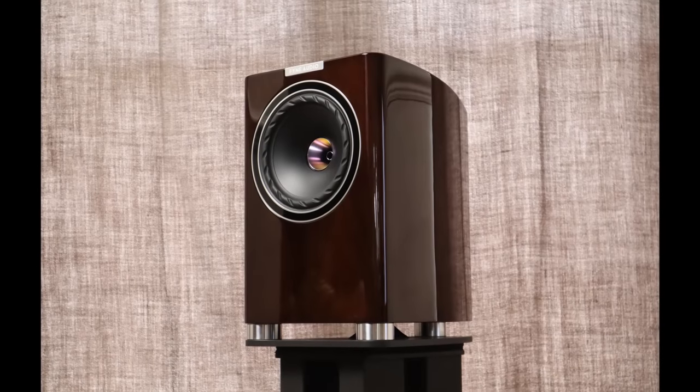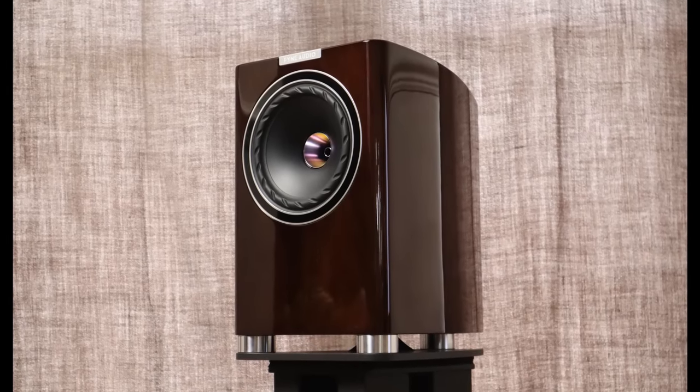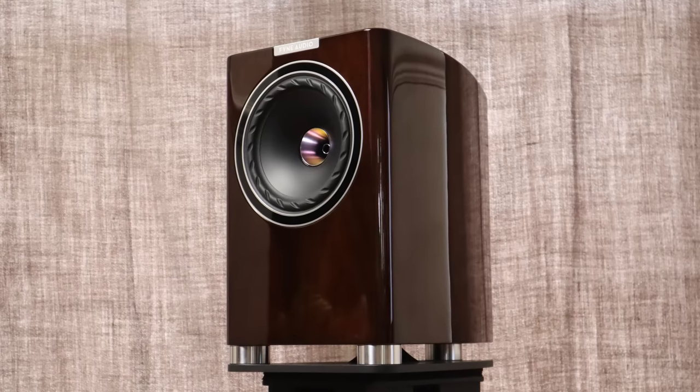Don't let me give you the impression that these speakers are bright — they're not. Sibilance is very well controlled and if anything they're a touch rolled off at the very highest frequencies. My ProAcs have more high-end extension, and the ATC SCM19s and ProAcs both have a little more of that airy spatial quality. The party trick of the F700s is how evenly they load the room with sound. There's good soundstage width and depth, and within that soundstage it's clear where you can locate instruments — what I refer to as imaging. The size of the sweet spot whether you move left or right, forward or backwards, or even up and down, is impressive. This is what you'd expect from a well-implemented dual concentric driver, and even walking around the room you get less tonal variation than with many other speakers.